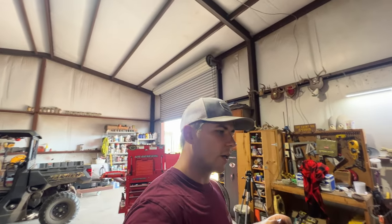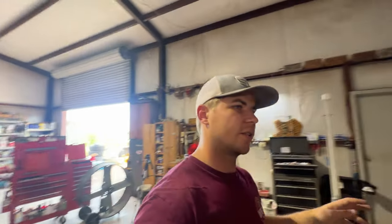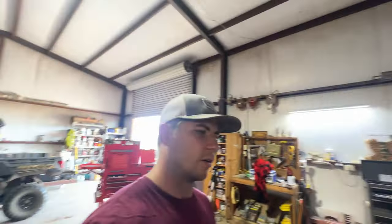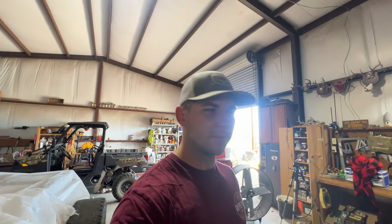A little bit of story behind which clutch I've got. I got the ceramic because I want something that can hold around 700 horsepower, and that's the goal for the truck right now. I almost went organic, but it was right on that borderline of holding all the power that I want, or, you know, having to step up.